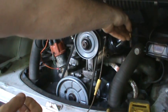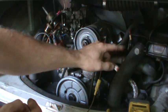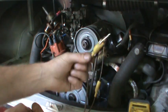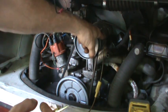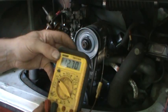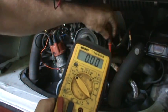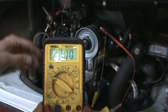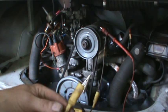I've removed the two wires off the generator — remember that the larger of the two will have power when you turn the key on, so make sure it's out of the way and not touching anything ground-wise. You can put tape around it if needed. I took a jumper lead and connected it to the DF terminal. D+ is the output; DF is the signal from the regulator telling the generator what to do. The hot lead of the meter goes on the output side. We're looking for anything above 35 volts when revved up. When I ground out the DF terminal, right now it shouldn't do anything.